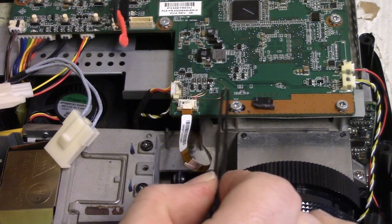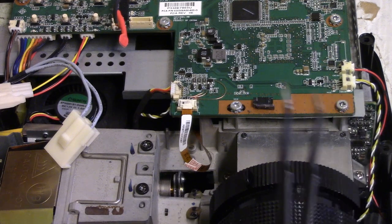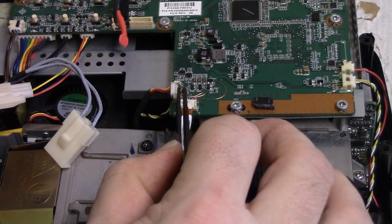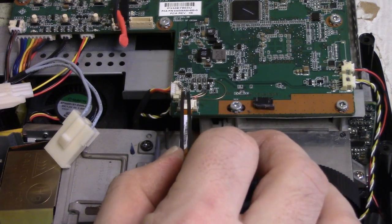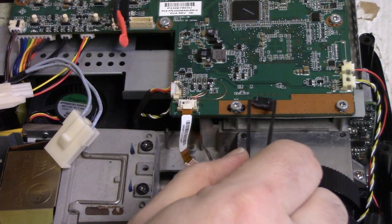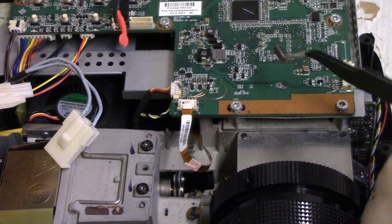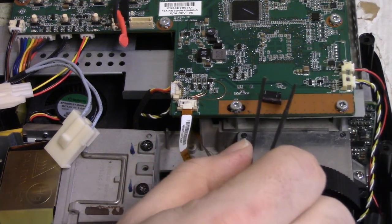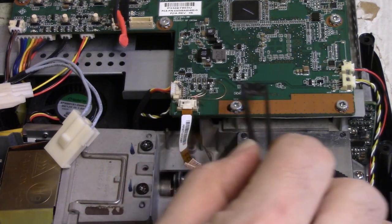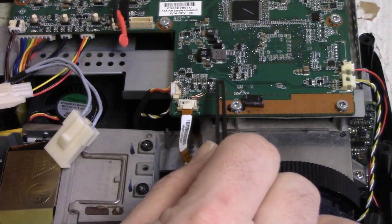So what I have to do is reverse the order of the wires, all the wires. I'm going to have to add that fourth one and make sure I cut the trace going to that pad right there. I might actually just real quick check and see if I have a donor board that has the same connector on it, because I'd really kind of like to keep that wiring. It's kind of nice, and just switch the connector. So I'm gonna go look at that real quick, and if not, we'll just flip-flop the wires.